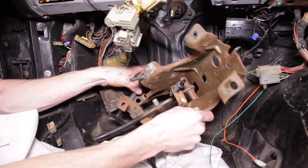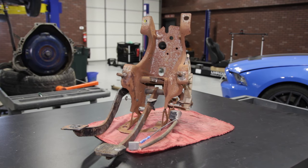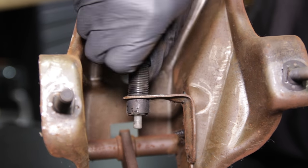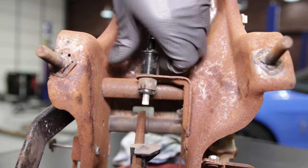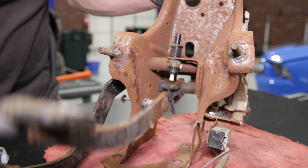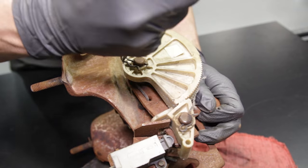Set the manual pedal assembly on a workbench. Take this time to transfer the brake dump valve and the insert if it's needed. This valve simply unscrews from the insert. When doing this, count how many turns it takes to remove the valve. Install the insert if needed and then thread the valve back into the insert.